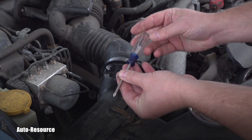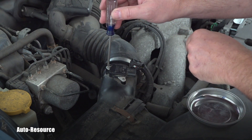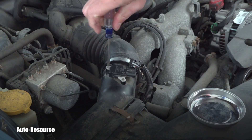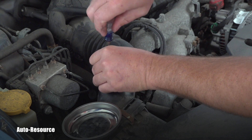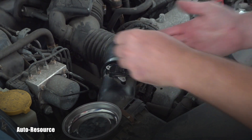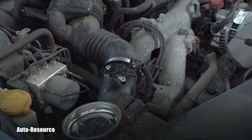Now there are two small Phillips screws — sometimes they are stuck, so be careful engaging them. I highly recommend you bring a magnet, because you don't want to drop those little tiny screws. It would probably be impossible to dig them out from the engine bay.